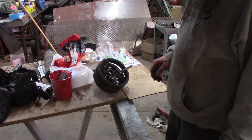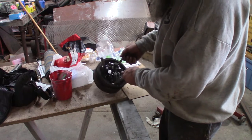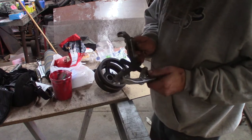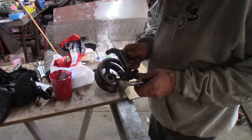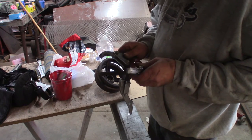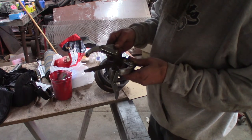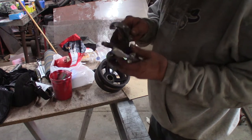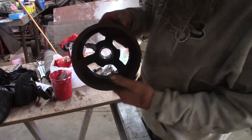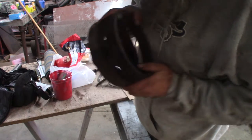I've just been bolting stuff off this old motor — most of it's not very exciting, but here's a little trick. This is one of these pullers you can get in a three-pack at Harbor Freight. I don't use these all the time. If I did this professionally, I'd be buying Snap-on or Mac stuff — even though that's all made in China now too. But this Harbor Freight puller, it's a cheesy one — made in Taiwan. Anyway, just a small three-jaw puller. You slide it past the low tooth, give it a twist, get the jaws behind each of the bigger ones, and then pull it off.